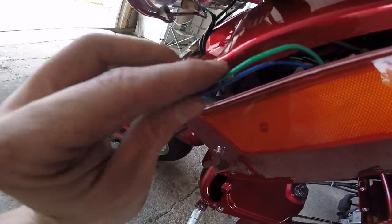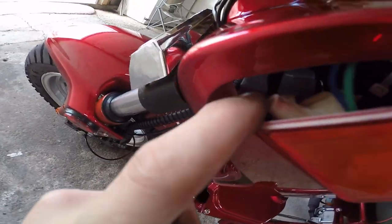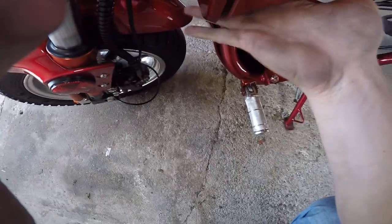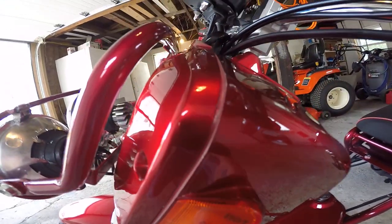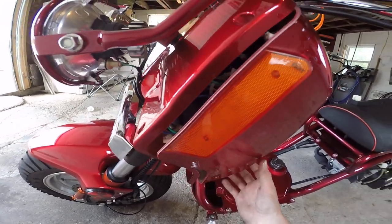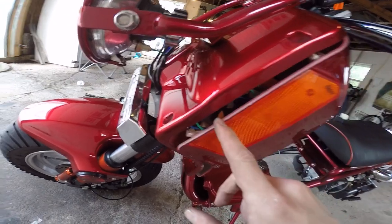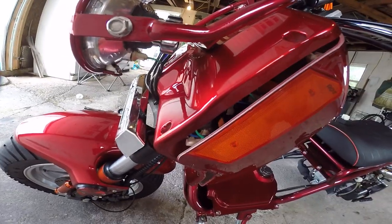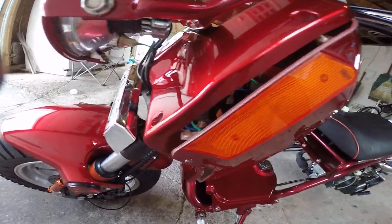You've got the battery box held back in place by the ignition switch. Make sure all the loose wires are tucked back in, then line up the little pins where the screws go, put the box back in there, line everything up, and screw it in and you're done. I'm going to have another video about actually tightening and fastening the wires because there's a lot of rattle that comes from the box itself with all the wires jumping around in there.